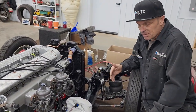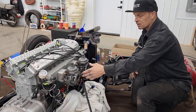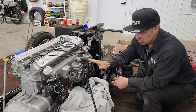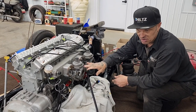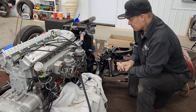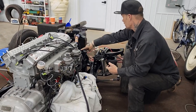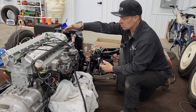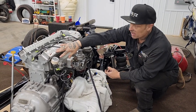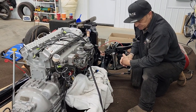When we started it up again, the fuel kept coming out of the carburetor. You see Nathan tapping on the carburetor, trying to get the needle valve to stop sticking. It did circulate, you'll see that in the video. It was circulating with the tape. We got that going good, so the heat was not that high. We had over 60 pounds oil pressure, which is fantastic.